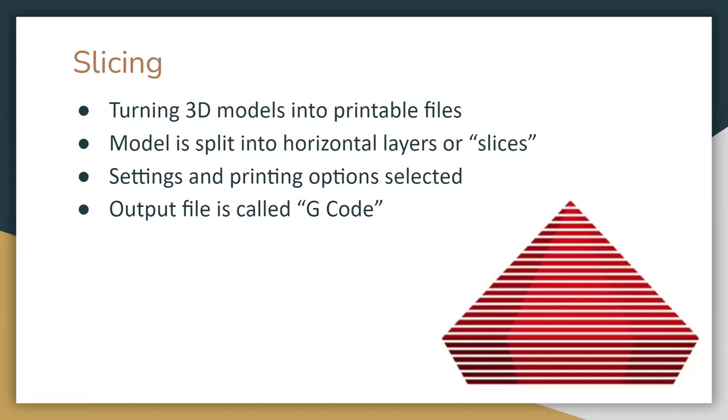So does everyone see this screen for adding a printer? Okay, so what you want to do is click Add Non-Networked Printer. And then you should see this big list here. Everyone see the list? Okay. And you just scroll down to Creality. Should be in alphabetical order. Yep, Creality 3D right here. So all of these are printers that the company Creality makes. And the one you want is Creality Ender 3/Ender 3 V2. They're both the same settings for those.